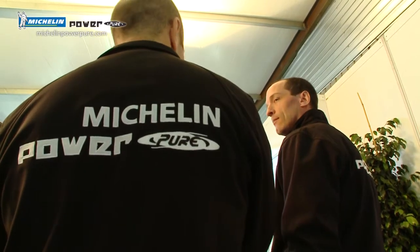It's a big difference when you're talking about unsprung weight. With my racing background, you have to imagine the suspension moving up and down at 200 miles an hour — that unsprung rate and also the gyro effect. We're always trying to lose weight somewhere, and what better way than with the tires, cost-effectively. Changing discs from carbon fiber to steel is astronomical — about a thousand euros versus eight thousand euros for a set of discs. It's about maneuverability: spinning that wheel at 200 miles an hour, that gyro effect — reducing that weight can make a big big difference.